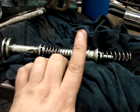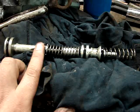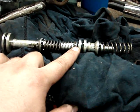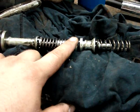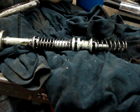So, with that said, if the rear brakes are on this cylinder, and the front brakes are on this cylinder, and the front brakes bottom out, then this can't push any farther. There's not enough volume of fluid to make the back brakes self-adjust and come on. So I switched the lines, made no difference, still have no brakes.